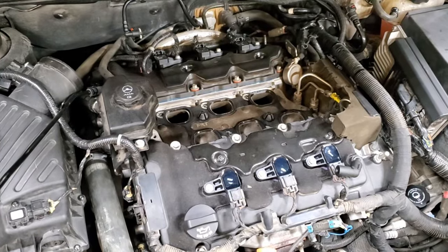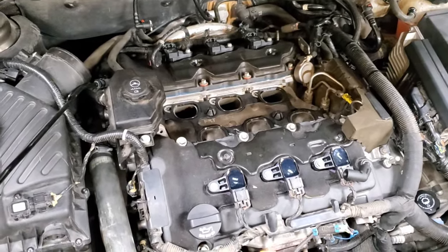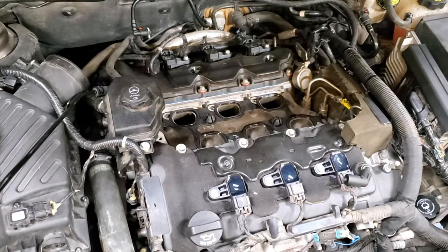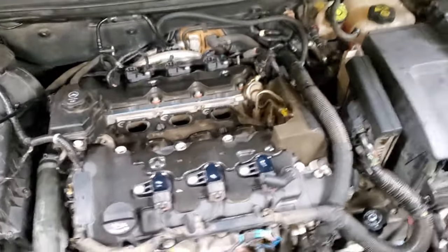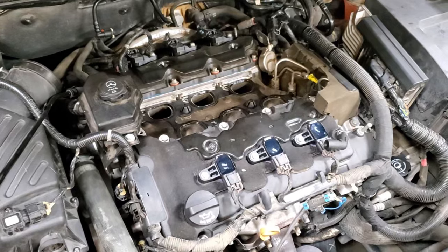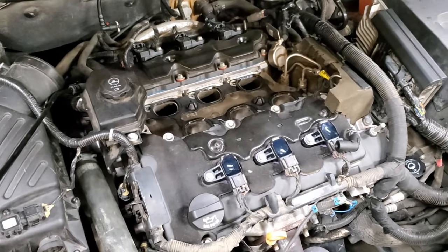After seeing the results, it looks like the only good way to remove stuck-on carbon deposits is walnut blasting. The BG products probably work well as a preventative maintenance thing — if it had been done every 30,000 miles as recommended, this car would have had that service three times already and probably would not have nearly as much carbon buildup. So I'm going to order a walnut blaster, let the customer take the car, and continue this video when it comes back. Right now it's at 100,276 miles and the date is January 20th — we'll see if more carbon falls off over several hundred miles like in the BG picture.